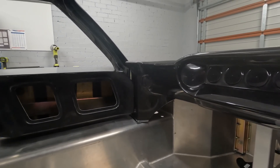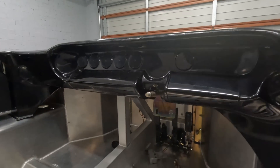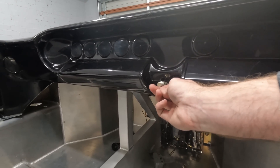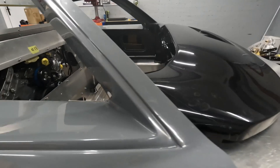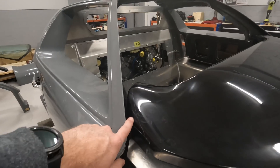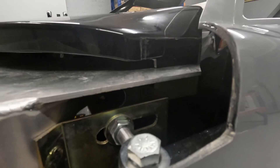For me that top section needs to come down. It actually wouldn't hurt for the whole top of the dash to be rotated down a bit to sit a little more flat on top. I did have to loosen off my steering column, but all in all it seems to sit okay. Basically if I was looking to drop the height a little bit, I'd be looking to take this step up out just to bring the front down, and hopefully then I won't need to trim much if anything out of this top corner of the dash for the A-pillar. Same scenario on the other side — it's about one centimeter or half an inch.